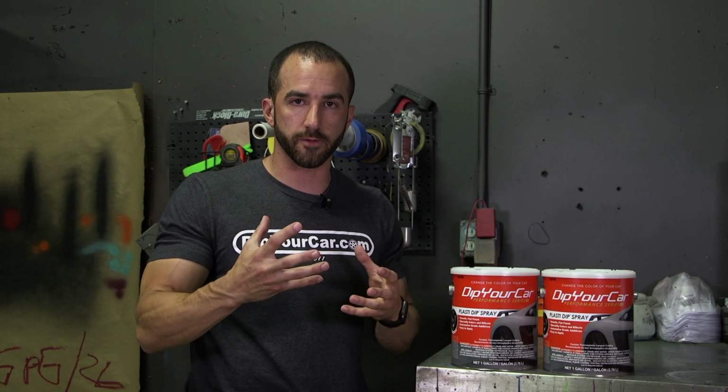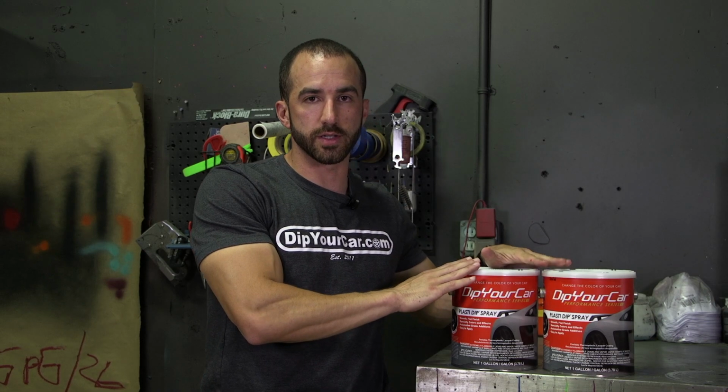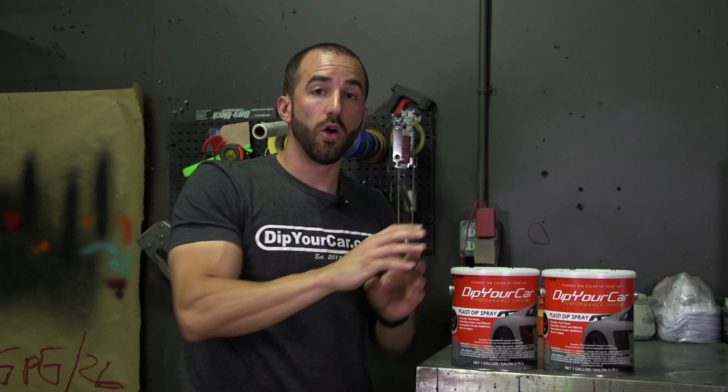We loosened the surface tension, we lowered the viscosity, and we made some other smaller changes that help it wet out and slick out faster and easier, and more importantly, level and dry smoother and flatter. You're going to notice that as soon as you put your first coat down. You're going to be able to get Performance Series down on your car and end with a flatter, smoother surface than a car that you sprayed regular Plasti Dip on or a car that you sprayed top coat and pearls on, no doubt about it. Flattest, smoothest DIY finishes possible.